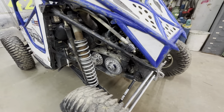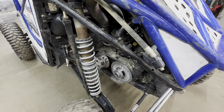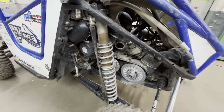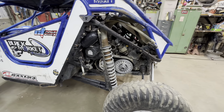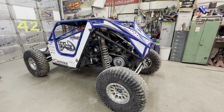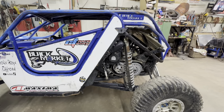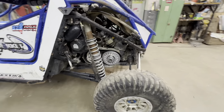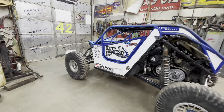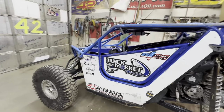I've got a clutch box coming in because it keeps spitting the belts out the back with the old style clutches. That's supposed to be here the next couple days. I threw the new clutches on it to hopefully try to dial them in a little bit before BMR. I didn't have much luck from the KWI stuff - spent numerous dollars with them and nobody seemed to figure it out. So we switched up and went with STM. I got a pretty good deal on a used set. They are a little bit noisy compared to a stock clutch, but if it'll keep the belt on it I'll deal with the noise.